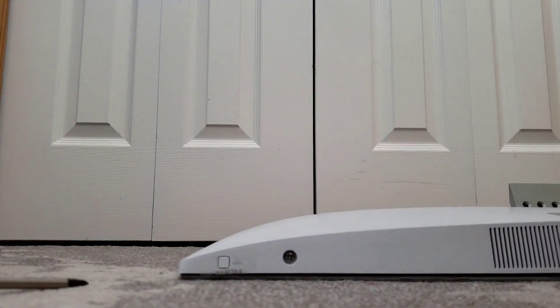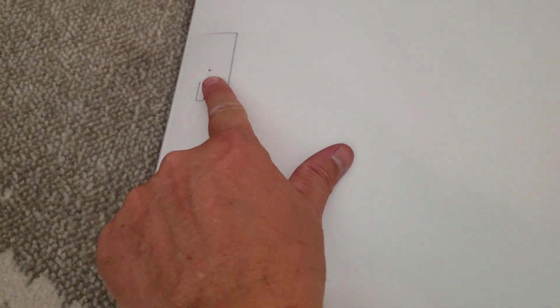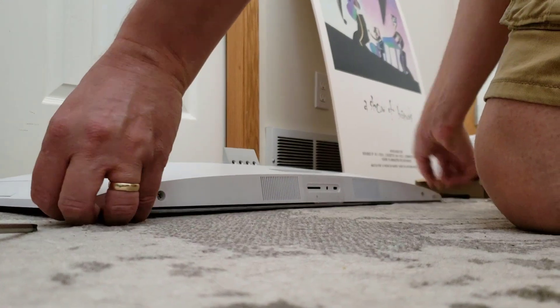That's lifting up quite nicely. Before going further, I want to address something: if you look at the side, this unit has a DVD drive and a pinhole. You may be tempted to pop the DVD out, but on the inside there's a long ribbon cable, so the back comes off just fine without removing the DVD. The DVD stays in the rear housing.